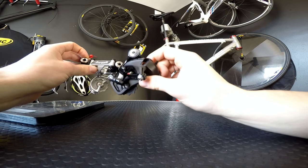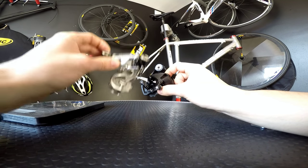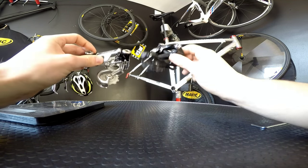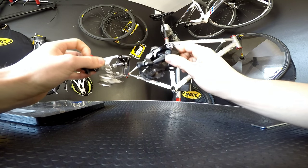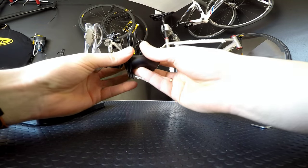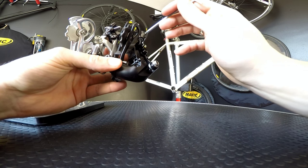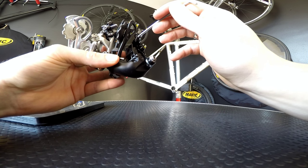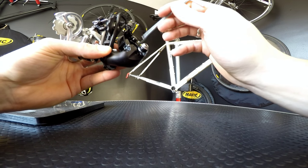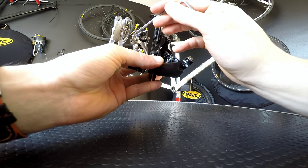This is what's changed over 32 years of designing and developing new technologies. I'm not saying this derailleur isn't good - it's okay. But this one is from 2015, this one from 1984, and still much, much lighter. The shifting performance today is a bit better, but I can also tell you one thing that is much better on the older Campagnolo Super Record: we see a huge turn that the cable has to make going through the barrel adjuster, the cable guide, and then up to the screw. On the old one it goes almost straight.